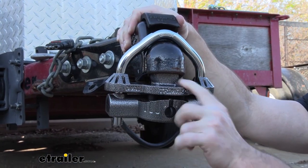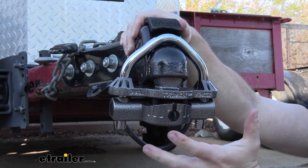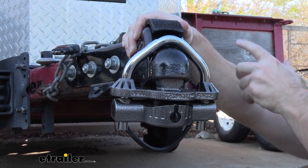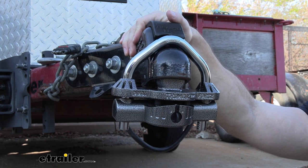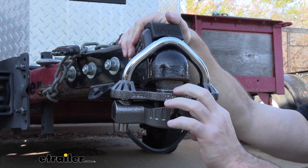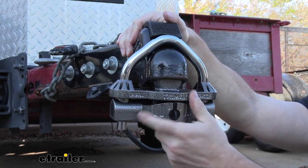The ball goes up there and fills up the coupler, which means nobody can just hook up to the trailer and go away. There are different kinds of locks you can put — usually barrel locks that go to the side of the coupler and keep the latch from coming up. Those work, but they're usually thinner and not as heavy duty. This is going to be a heavy duty lock that fills up those gaps so you can't even get tools in there to really pry on anything to get it off.